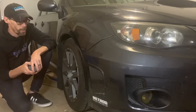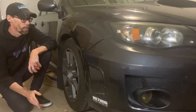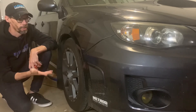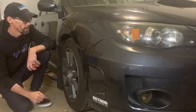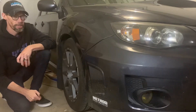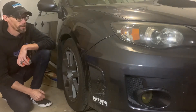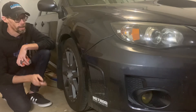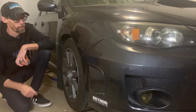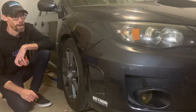The first thing you want to do, whether you're installing for the first time and setting your initial ride height, or whether you've already got ride height set and need to adjust up or down — in this case the current ride height all the way around is 26 inches. Stock 2011 WRX is 26.6 in the front, 26.2 in the rear, so we're about a quarter to half inch lower all the way around. I ideally want to set the ride height to 27 inches, just a little above stock, nothing crazy.